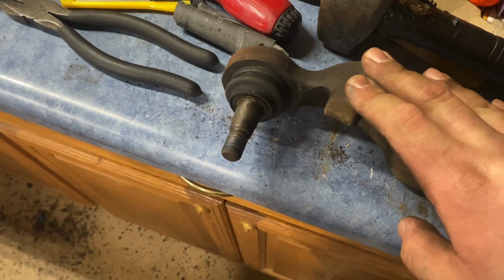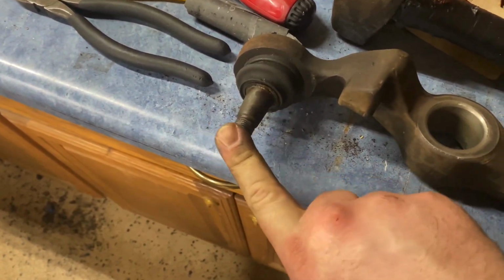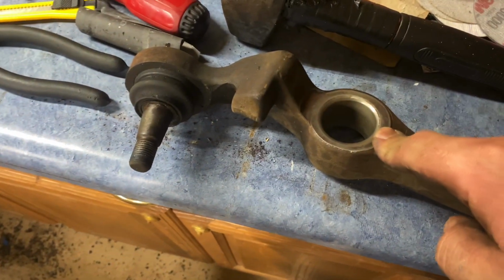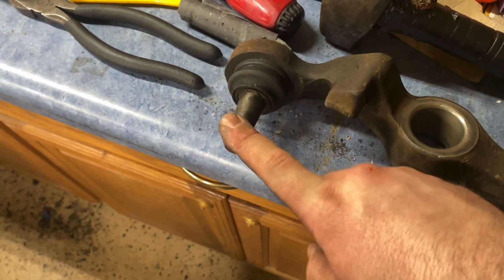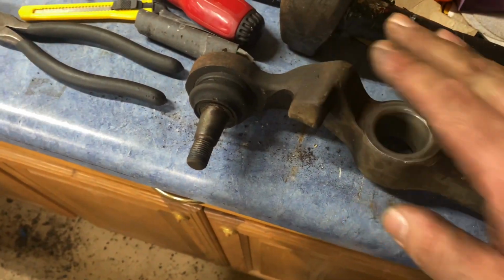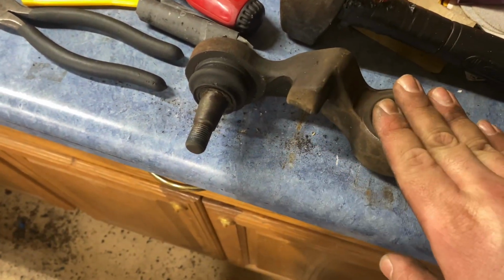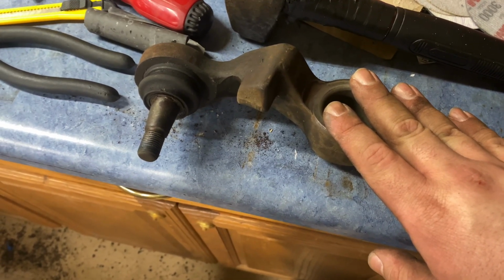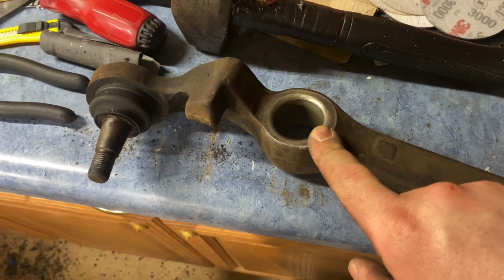If your vehicle is a daily driver, it sucks, but you really want to just go ahead and buy brand new lower control arms. Whiteline sells them with bushings already installed. So if this is something that you need, I would highly recommend buying Whiteline lower control arms with bushings pre-installed, brand new ball joint, yada yada. Save you a lot of headache and hassle trying to get your old bushings out. But I will try to film installing the bushings, but we are in the home stretch.